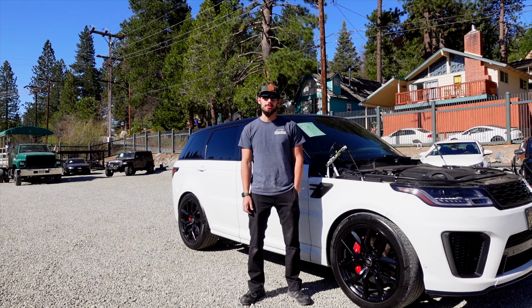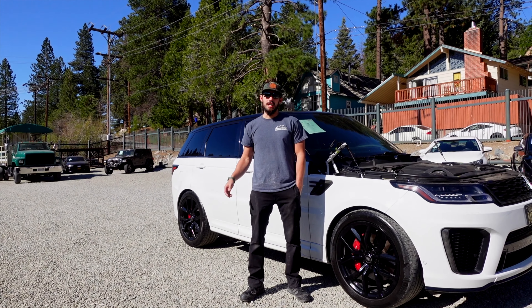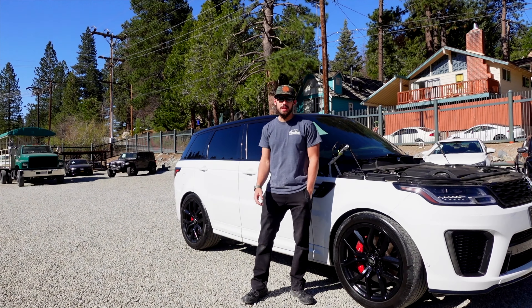What's going on guys, this is Tyler coming to you from Showtime Collision. I wanted to give you guys an example on this pretty cool car we're working on today. It's a 2016 Range Rover Sport SVR. This car came with a lot of carbon fiber options, which is really neat and unique. But only after four or five years of ownership, the carbon fiber finish on the hood was failing — the clear was delaminating from the resin. The customer looked into getting a new hood and found out it was $8,000 for a brand new one, and he came to us for our professional opinion.